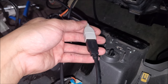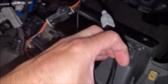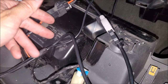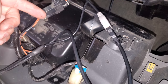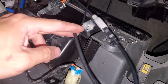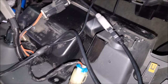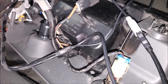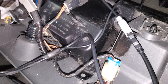All you have to do is plug it in now into the USB coming out of our head unit. Keep in mind, try to buy units that have a really short USB pigtail — you don't want it too long. It'll work fine if you're charging your phone or running music off a USB thumb drive, but where you might have issues with a poor quality or too long cable is Android Auto or Apple CarPlay. So make sure the cable you're plugging in on the front side is original — original Apple or original Samsung or whatever Android phone you have — for best performance.